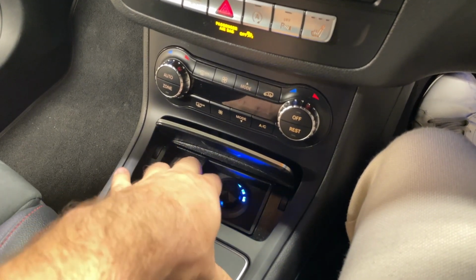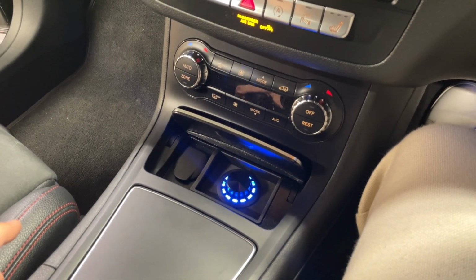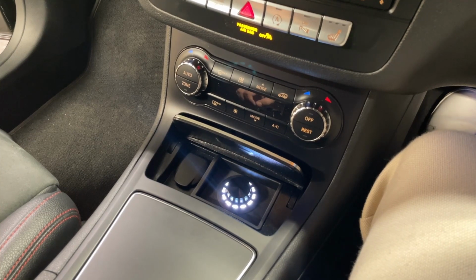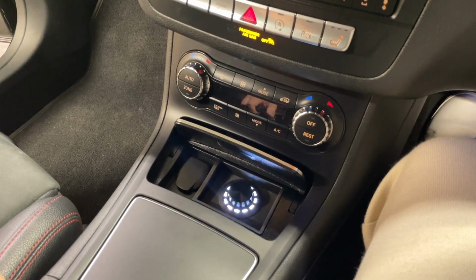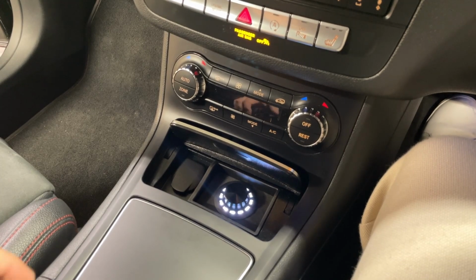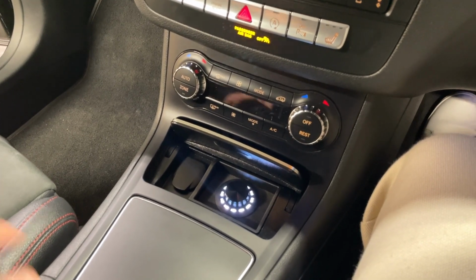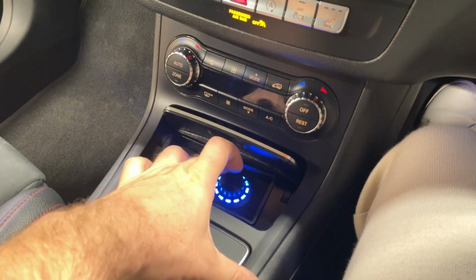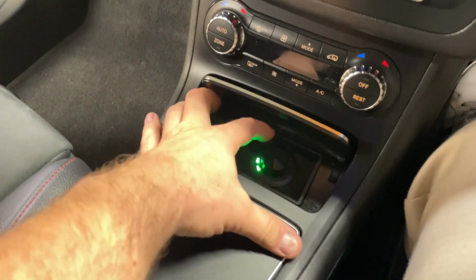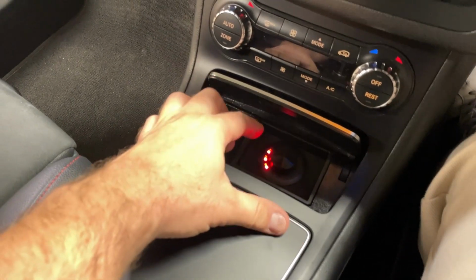Then here you have rear fill, so you can control the rear doors, which was set up 2 different ways. I mentioned it many times in the videos. If we have rear fill, we can set it up normally, where the rear fill plays exactly the same signal as the front doors, especially if you have rear passengers. Or it can be set up as differential, when it doesn't play anything mono, and it sounds more like an effect speaker, and it gives you more room information. It sounds a bit reverby, and it's quite cool. Many people love it. And then the level can also be controlled here, set to personal liking. So that's it, and that's why we have two presets. First preset with the rear doors running full range, and the second when it's running differential, and when it turns to red you have no more presets.